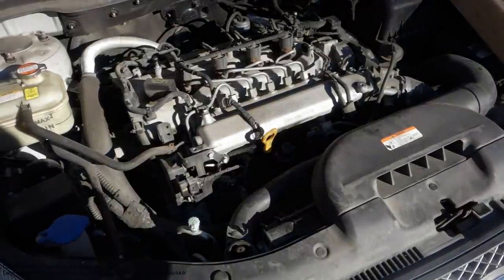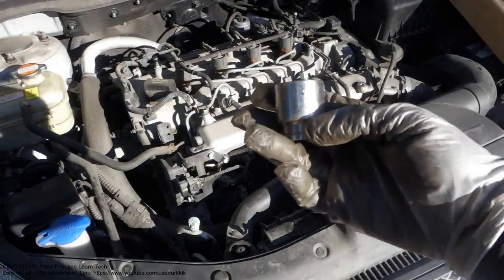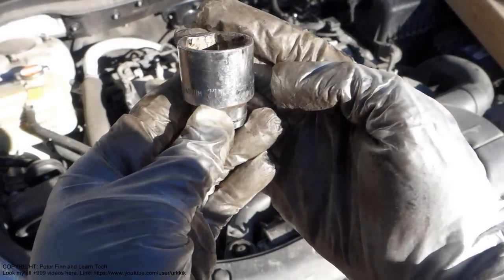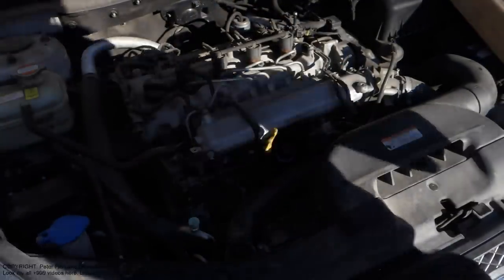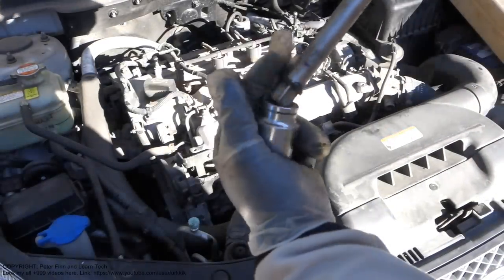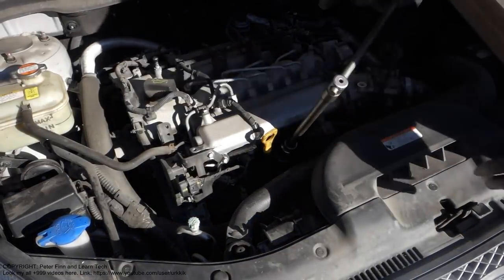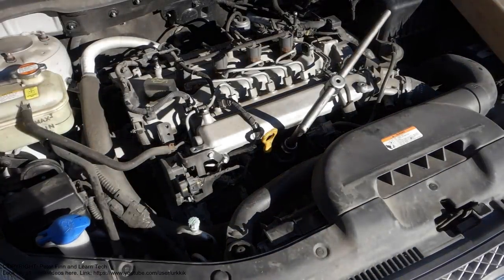For that job, we need a new socket and tool. Now we need this little bit bigger socket. What size is this? 27 millimeters, and that part fits this oil filter cover. And again, we need that T-bar socket and this opening tool, and this part fits in here in that way. When I start to rotate in this way, this filter cover opens. And let's look closer.